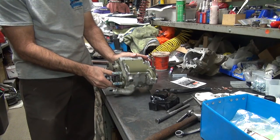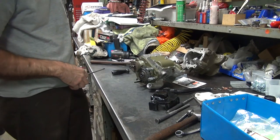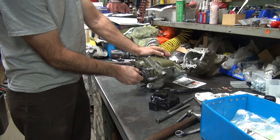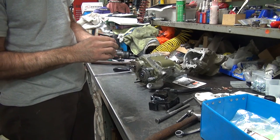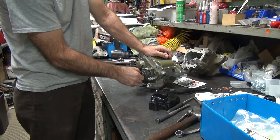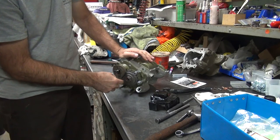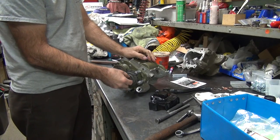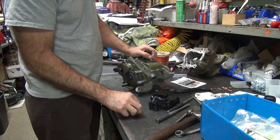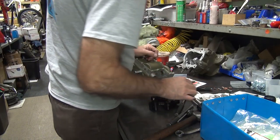Boy, that new hardware sure looks nice. So you don't like this screwed up nut on here? Well, if somebody hadn't used a chisel on it, I guess. It's pretty loose, too. Is there a lock tab that goes under that? Yeah. See how this is on the shaft here? It wobbles around. Why is that? Probably because the threads on the shaft are made undersized. Oh, great. I doubt there's a nut. I don't think I have any more new nuts. All right, well, that's okay. Let's see that one. It's not that bad. Used. Some lock tabs floating around somewhere.